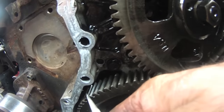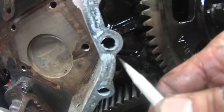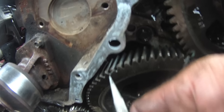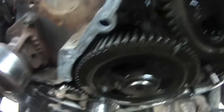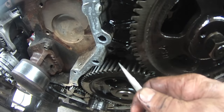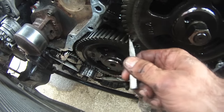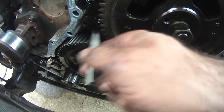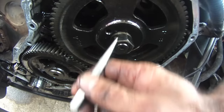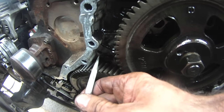The pin could either fall out and go this way, get pinned between the gear and this timing cover. Because this cover is separate from the engine block — it's aluminum. If this little steel pin got in here, by the time it got about here there's not enough clearance. Steel pin versus aluminum housing — the aluminum housing is going to lose every time, and it will blow out the side of your timing cover. The other option is it could get caught between the gears, bounce around until it got jammed up in there. Steel on steel on the cam and crank — something bad is going to happen. But here's what we found out: that's a lot of talking to find out that the pin is still deep-seated in there.